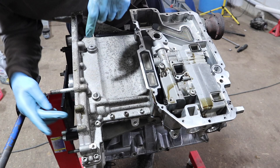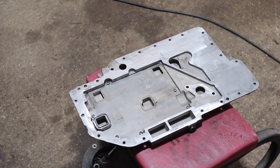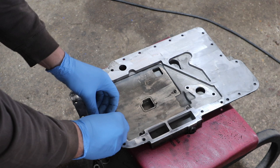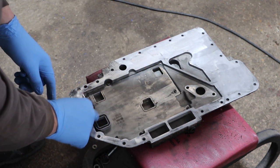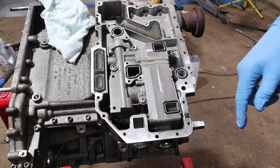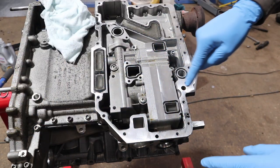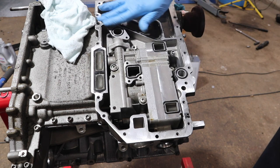That is now fed into the gears and it's just sat there ready for the timing chain assembly. For the final sump - the last piece to the bottom end - I just need one little gasket to go in here. The other gaskets on the oil pump sit there already. I'm going to put the sealant around this part instead of around the sump, because these are tighter edges and I've got a much better chance of getting a good seal.